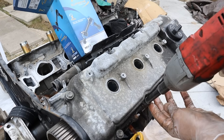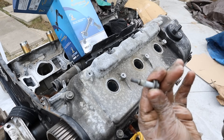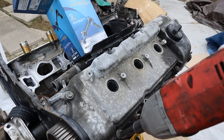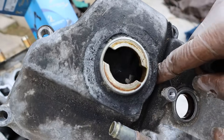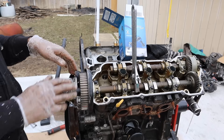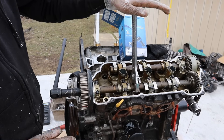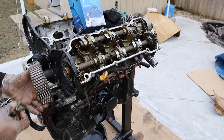This front valve cover bolt is super loose — no wonder this whole front is leaking. Probably a good idea to add a washer and tighten them down if you have a loose bolt problem. Again, it's really clean inside. For those of you who think an engine is in bad shape just by looking under the oil cap — check this out, it's completely clean underneath. Now remember this camshaft gear that was giving me trouble? The proper way to take it off is to put a wrench on the wrench flats here, and now I can remove that gear and the shield.